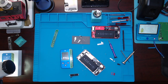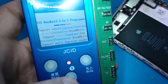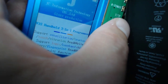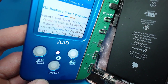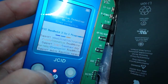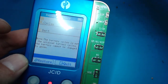I'm going to switch to a side camera here. We'll power this up and then connect the iPhone 7 Plus battery — and as you can see, I'm not getting any reading at all. This was a water-damaged phone, so obviously you wouldn't want to use the battery if it was water damaged. As we can see, it doesn't even show up — no reading, nothing. Connector looks fine, everything checks out, so it's a bad battery due to the water damage.